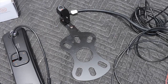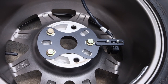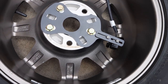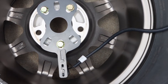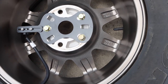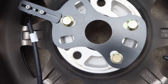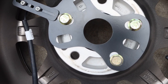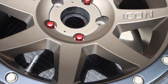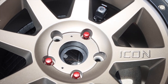The rear camera mount comes with two brackets — a short bracket designed for factory offset wheels, and a long bracket for wheels with larger offsets. Because my Wilco tire carrier uses a wheel cone on a threaded hub to hold the spare tire instead of regular wheel lugs, I customized the installation by using regular lug nuts and bolts to hold the camera mount on my spare wheel. The elongated mounting holes on the bracket make adjusting and centering the camera mount very easy, and the center wide opening does not get in the way of the tire carrier's mounting hub.